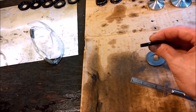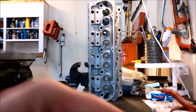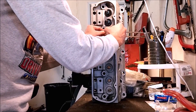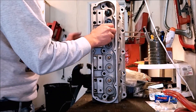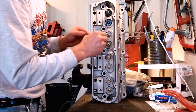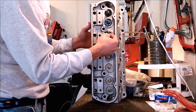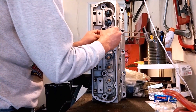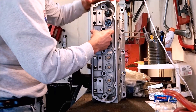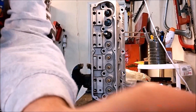So we can select our shims, measure the thickness of our retainer and shims to achieve that. We'll take the shim pack and spring pocket retainer that we think will get us where we want to go, place it over the guide. You can buy packages and kits of these spring shims from Summit or JEGS or wherever, so you have the assortment that you need. Then we're going to measure to make sure we did our math right.